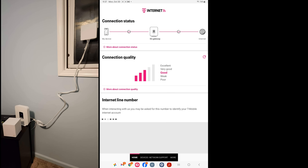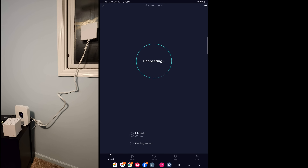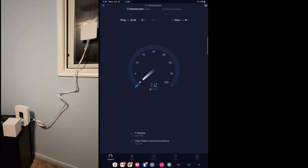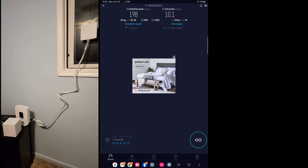I'll put links to the data sheets I found as well as installation instructions in the description. Now let's test the unit. Here we are with just the stock G4AR gateway using its internal antenna as a baseline. We're on B2, the bottom shows 'omnidirectional' which means it's using the internal antenna. We can see our signal values for 4G and for 5G N41. Now let's run a speed test with Speedtest.net finding its optimal server.